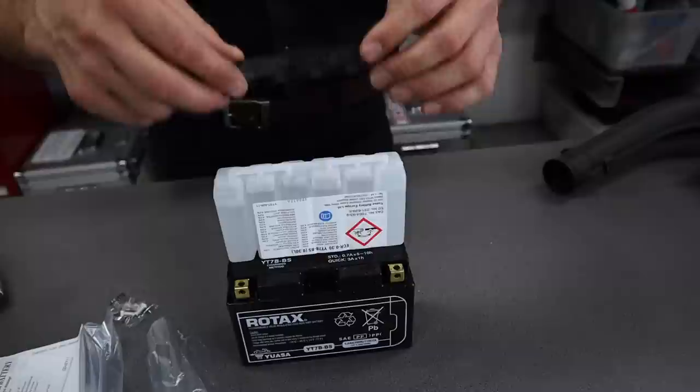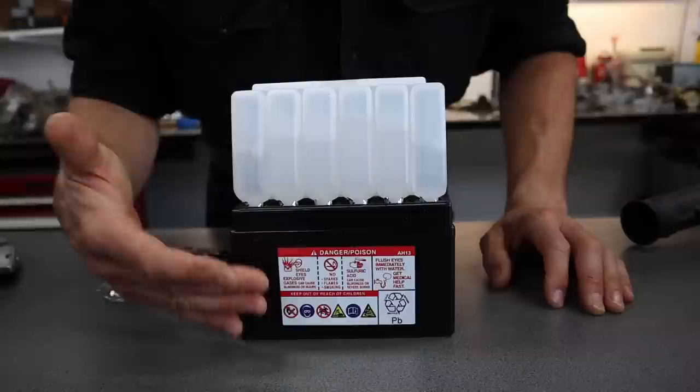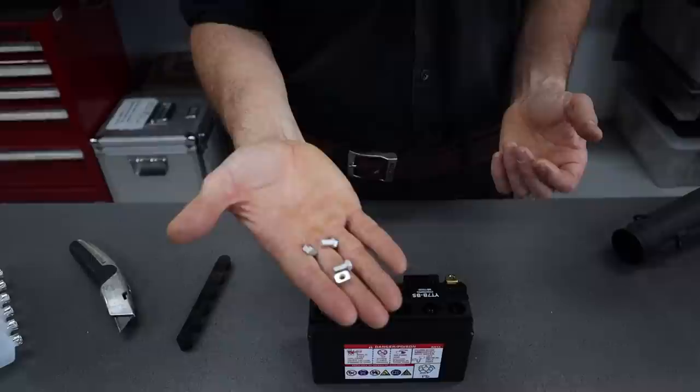The battery will get a little bit warm and then you can put the cap on. It just slots in. You remove the bottles, put that over there and seal it up — it's good to go for the life of the battery. The levels may look a little bit different, but don't be alarmed — they self-level once the fluid drains into the battery. Once the acid has all drained out of the little bottles, throw that away and leave this to one side for 30-40 minutes, then put the cap on and charge the battery.